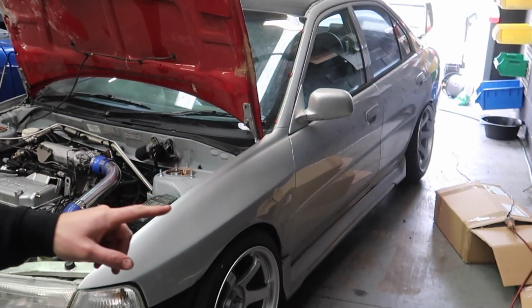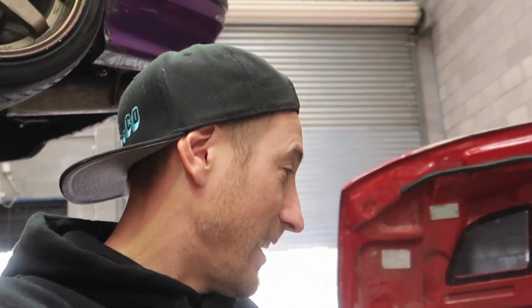I'd like to start by saying thank you guys very much for commenting on the last video and letting me know I have the front brake calipers around the wrong way, left to right, and the nipples are pointing down, and apparently having your nipples point down is not a good thing. Your nipples should always point up so you can bleed air out of them. So that kind of works across both platforms. So first thing we're going to do is swap the brakes around so that they are on the right side, and bleed them up to make sure we have brakes.